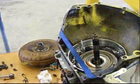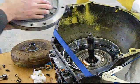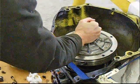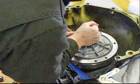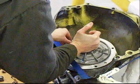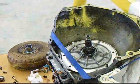Now this is just for demonstration purposes — we're not going to keep that in there. We're going to take the oil pump and put that on there. Remember to put a little grease around that o-ring. We're going to set the oil pump right in the guides that we put in — she's going to fall right in. Give her a little bit of a push and she snaps in.